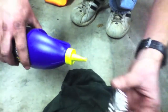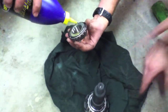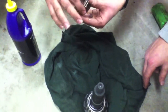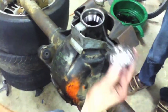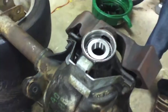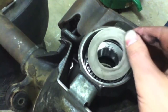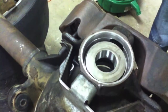Now we're taking our bearings - this is the pinion bearing for the front, and we did the same down below. We're putting a little bit of gear oil in here just to get it pre-lubed so it's nice and wet by the time we start turning the wheels. With our inner race installed, we're going to put the outer pinion bearing in, just head first, and get it to sit in there nice and flush. Then we have what's called an oil slinger - this piece goes in here to help deflect oil that's being pushed up on top of the front of the pinion.